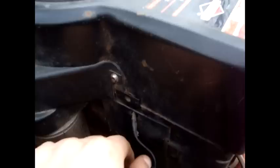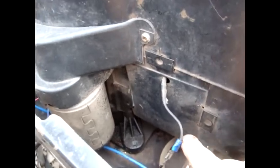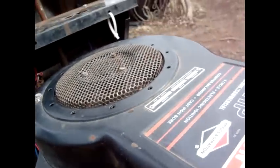This is going to my coil, which is giving power to my spark plug. Now, if this is grounded at all, it'll make it so that the coil won't give spark. So when hooking this up, you've got to make sure that on would be with the power on, and off would be the ground.